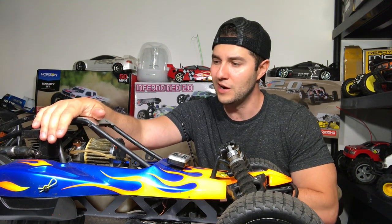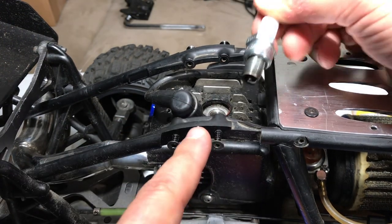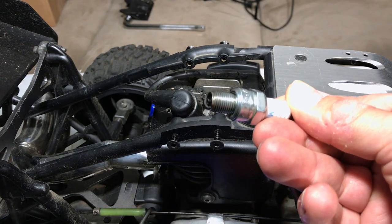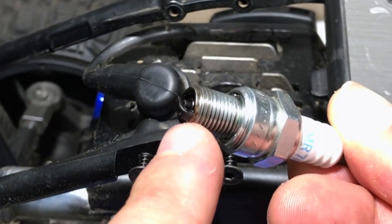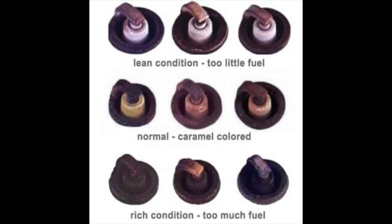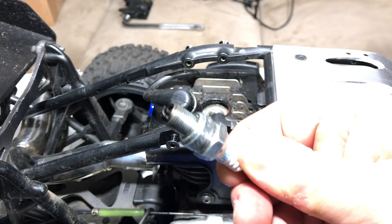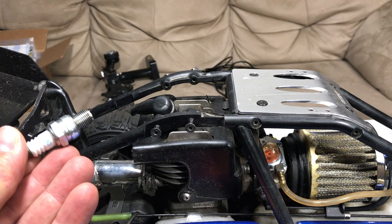Long story short, it came down to a bad plug. I don't know exactly how it got fouled, but one of the most classic ways to ruin your spark plug is running too rich or too lean. I'd say I'm probably running on the rich side. We're gonna remove the plug and take a look at it — just by looking at the plug you can tell how to tune your engine. I've already tested it and confirmed it doesn't work. As you look at the tip, it is fairly black, which is a sign I'm running way too rich. A lighter charcoal color would indicate running too lean. I'm gonna put a chart here for you guys to save.